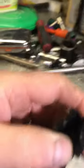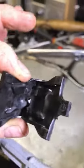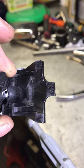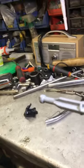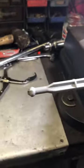I'll take that off and show you the wear on it. That should be round — there's the cage, which I've taped up because it's snapped in half. You can probably see the wear inside: it should be rounded but it's worn oval. That gives you excessive play which, although it doesn't look a lot, accounts for a lot on the pedal travel. You need to replace the master cylinder.